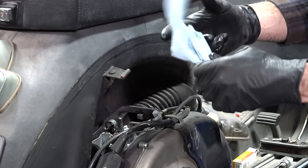Pull that screw out — oh yeah. The screen came out with the rubber gasket. There are some weird little chunks in there, probably from the fuel line. It's always a good idea to have a carburetor gasket kit on hand — I can already tell we'll want to replace some gaskets, such as the cover gasket which is pretty distorted. We have one of these ready to go: part number 154754, original Dellorto gasket kit. The sediment in there — it's actually paint from the spray paint job on the scooter, which came out pretty easily.